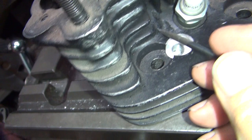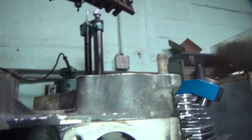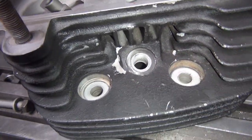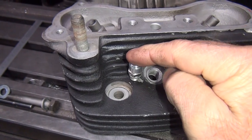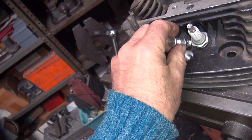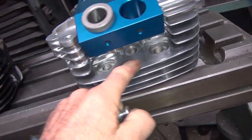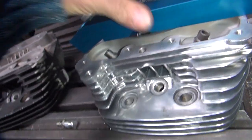If I move this out a little bit it would get out of there and be junk. Now the port is right here underneath — it's way up inside, way over here. My scribe mark is right here where the fin is. So what I was thinking about doing was putting the compression release right in here, which would be right next to the spark plug — right in this area at a fairly straight-up angle. That'd be a lot cleaner looking because it wouldn't be down in a big hole; it would be sitting up on top of the head.